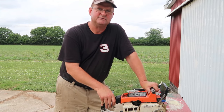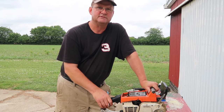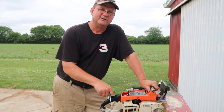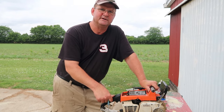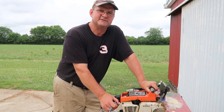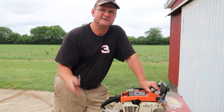That's the process I use to diagnose and repair small engines — not specific to this model, but any two-stroke small engine. A lot of times people say it'll cost more to fix than to buy new. In this case, we brought an old piece of equipment back to life. Don't throw your weed eater in the trash every year — take it apart, it's probably a dirty carburetor. Clean it up, make the adjustments, and put it back in service. I hope you learned something. Subscribe by hitting the Happy Wife Acres logo — go fix some equipment!